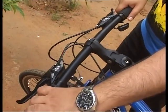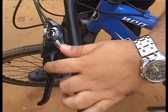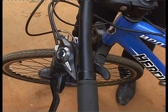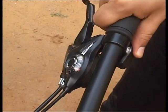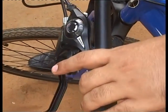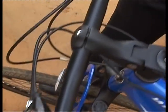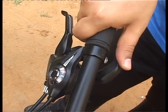We've seen how to move from ratio one-and-one all the way to three-and-seven — that's the full 21-speed range. Now we'll see how to go back. We're currently at three in the front and seven in the rear. To move back: press the top lever to go from three to two on the front, then press the rear lever to move from seven down to six, five, four — then move the front from two to one, and continue the rear from four down to three, two, and back to one.